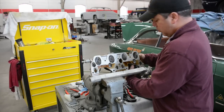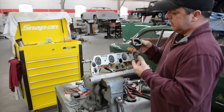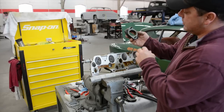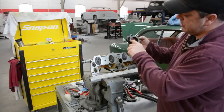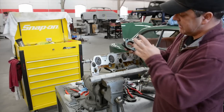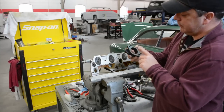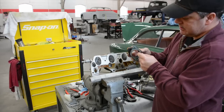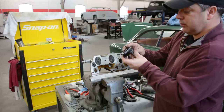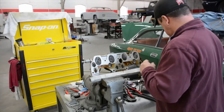Okay, I'm taking off the number one just simply so I have something to compare when I take off the number two intake. Now, for all intents and purposes, this is fairly normal. You see a little heating around the barreling here. That just means during the tuning process, you probably had some hot gases popping back through, and it starts to heat up the gasket a little bit. But there's no perforation in the gasket, and it's still tight against the boot. The boot has absolutely no tears, and well, they're brand new and they better not.